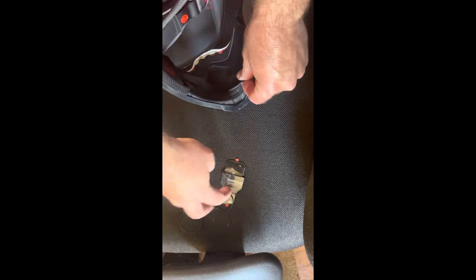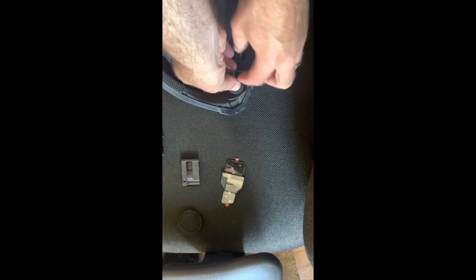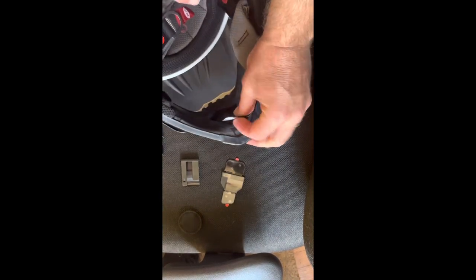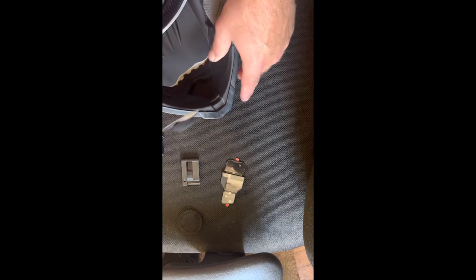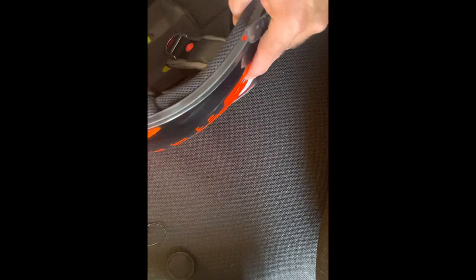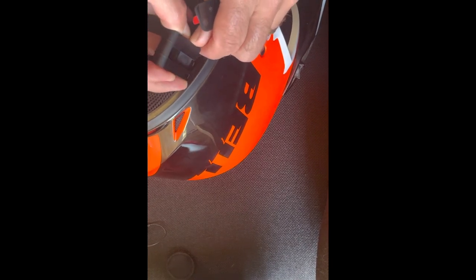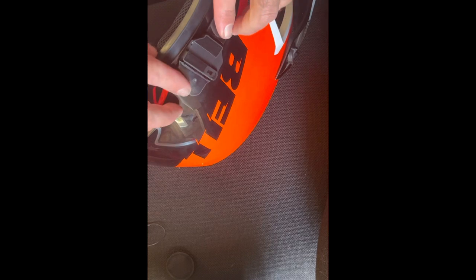At this point I was thinking I'd use the soft wire microphone like I did in my Arai helmet, but playing around with it more, there's not as much padding in this helmet — the Arai has a lot of padding which lets you tuck the wiring away. On this helmet, because dirt bike helmets have more of a pronounced chin, the boom mic actually fits in there really well and you don't have to hide the wiring. So I ended up going with the boom mic. The clip attachment can slide under the lip liner on some helmets, but this helmet is too wide for that, so the adhesive version is the way to go.